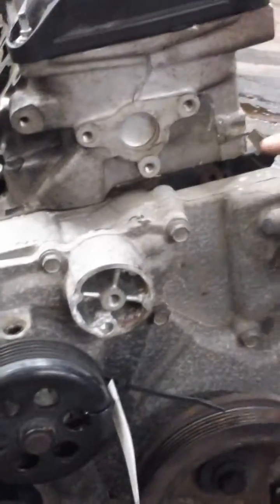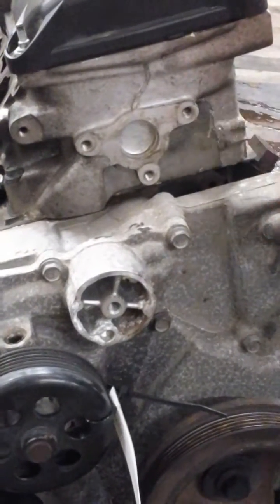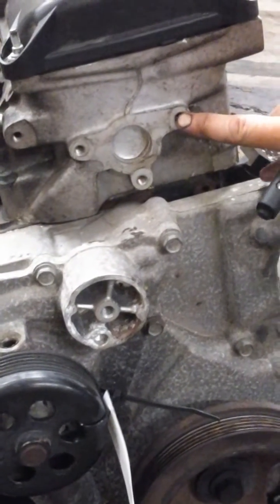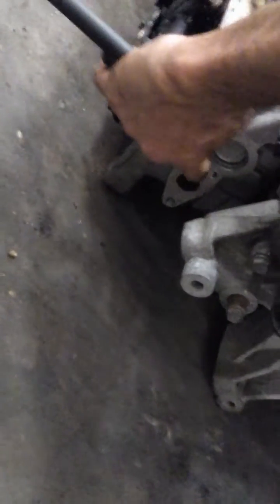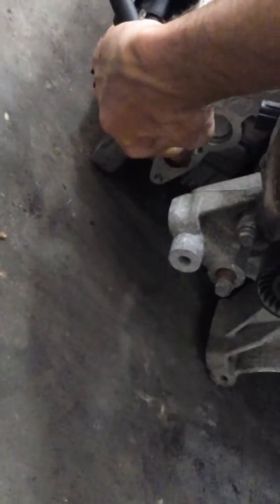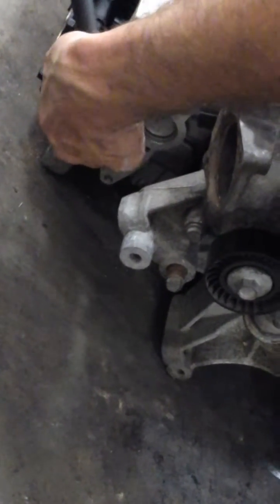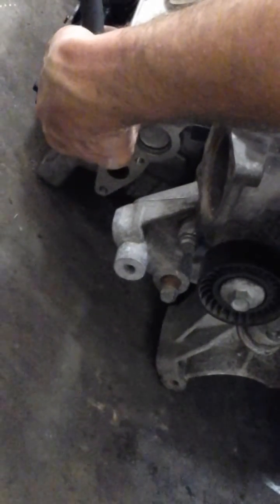See here? ATK has this, but they use a lot of stock photos, so some of them that don't have the holes they show with holes and vice versa. So it's going to come down to whether or not it has that, and whether or not it has EGR. You don't have the EGR valve actually on it, but you can see the soot and carbon buildup around it — this is an EGR head. It'll be just about a quarter inch deep and perfectly clean if it's a non-EGR head.